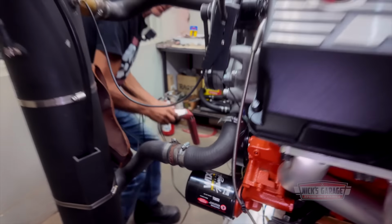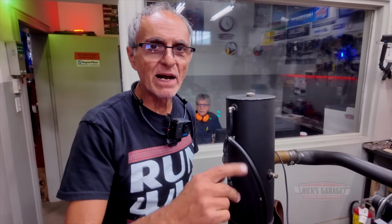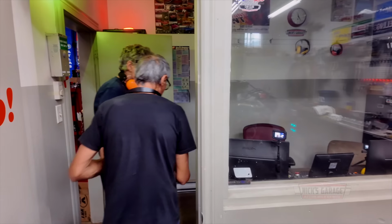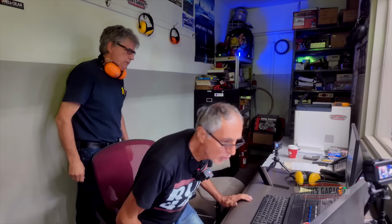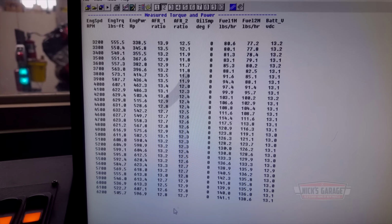So we backed up the timing to 28 degrees. We backed it up 2 degrees, and we're going to make another test back to back. Do we need them? No, I'll take it off. Hold on. It's 12.8, 12.9. So if it's good, we're going to take them off, because you're taking current for nothing. Hold on. Let me just check the air fuel ratio. Oh, it's right on the money. Okay, all right, there's the air fuel ratio. It's pretty good. So I'm going to take them off.